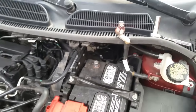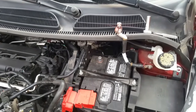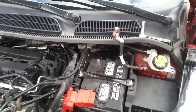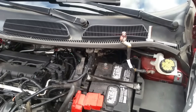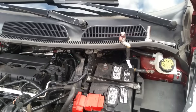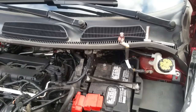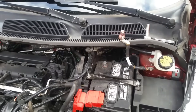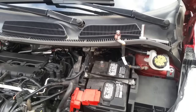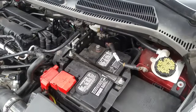I'll leave the battery disconnected for approximately five minutes and then come back and reconnect it. Don't forget, my ignition is on, so when I get back inside the car that should wipe out all the codes. If you turn the ignition off and remove the battery cable, for one reason or another it saves the codes and they come back on the dash — I already tried that.